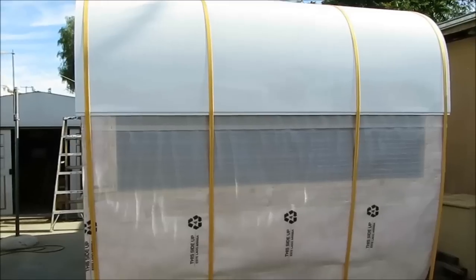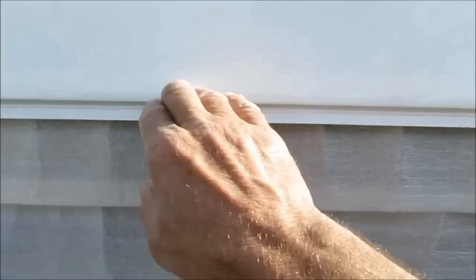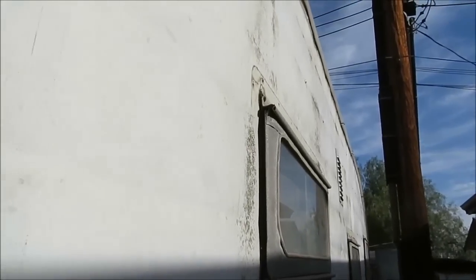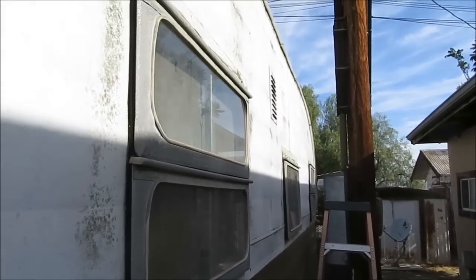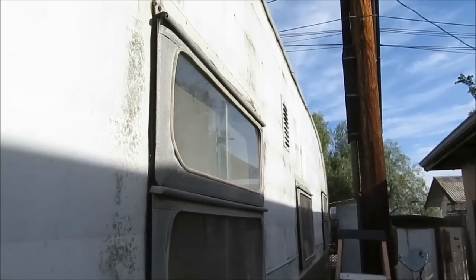There you have it — this is a very important step, it really makes putting the metal on easier. Make sure that your seams are level with the windows — you've got a front and rear window usually in the trailer — so make sure your metal is on nice and square and level front and rear. Make sure you have enough overhang to be able to fold it over and get a good seal before your J-rail. When you cut your metal, cut it down to a half-inch overhang — no more — because your overhang can't exceed the width of the J-rail, which is only three-quarter inches.